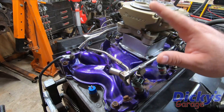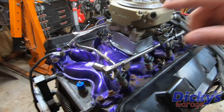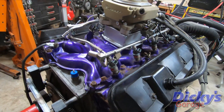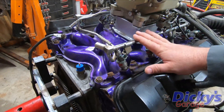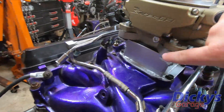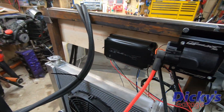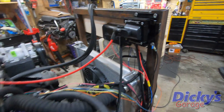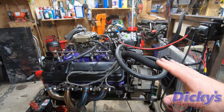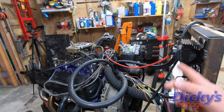For fuel management, I'm going to try to run factory fuel injection. My injection is OBD2 — I've got a very late model 460 computer that is sequentially fired with mass air. For the test stand I'm using my Holley Sniper, bolted on top of an adapter I've made. I've also got a Holley HyperSpark distributor, HyperSpark CD box, and the Holley Sniper coil. This isn't something I plan on putting in the Lightning, but it's plan B if the factory fuel injection can't handle it.